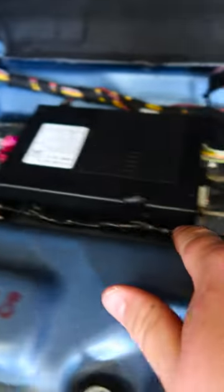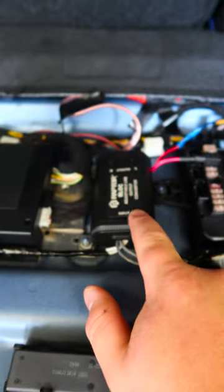You get the left from the speaker here and the right from the speaker. You pull this panel off and you get access to the wiring under the speaker. See those two red things? Left and right terminals. Run it down through this wire to the line output converter.